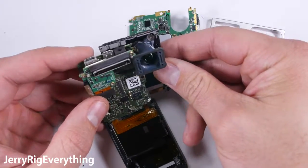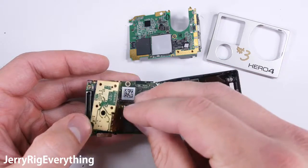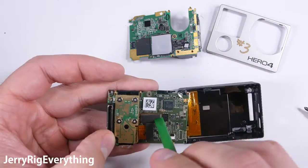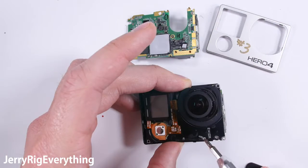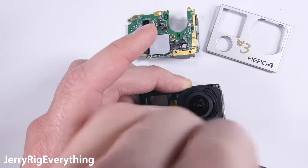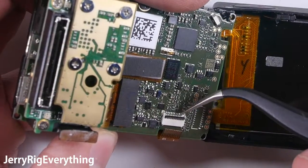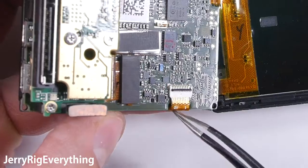Slide the lens into the motherboard. This is good information to have because if you have two broken GoPros you can Frankenstein them together into one working one. Or you can buy broken GoPros locally off Craigslist or eBay and splice them together and make a little bit of cash. Take the sensor, put those 4 screws into place, and use the Lego connection to get it back on the motherboard. There are 2 screws on the front of the housing and 1 screw on the rear. You can also buy replacement LCDs and lenses — basically everything on this GoPro camera is modular, which is very convenient for repair.